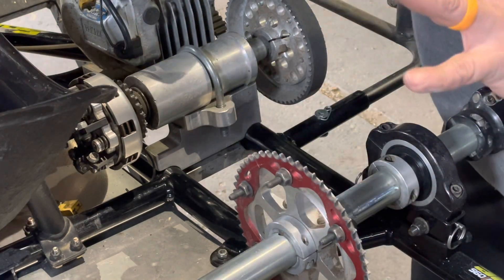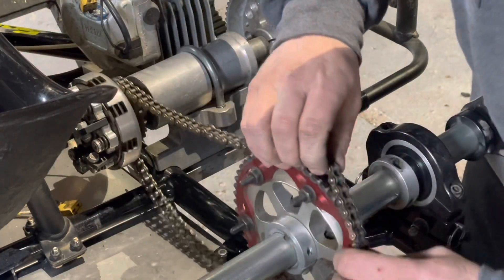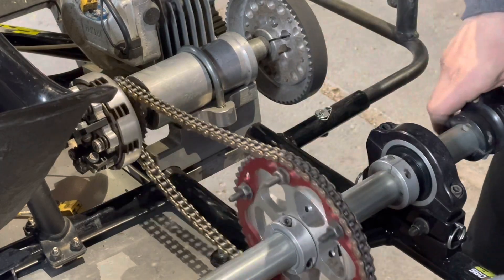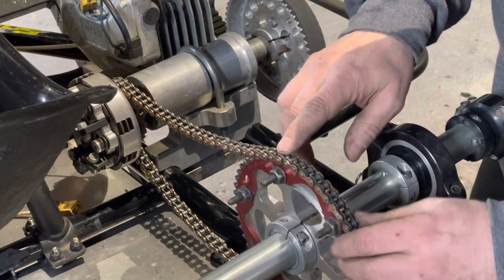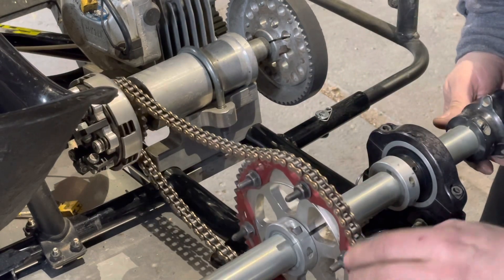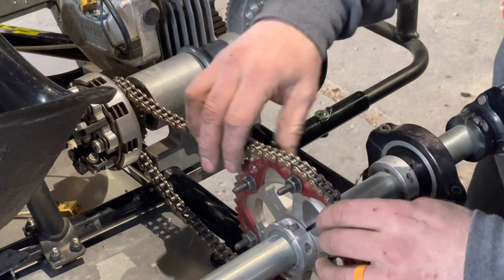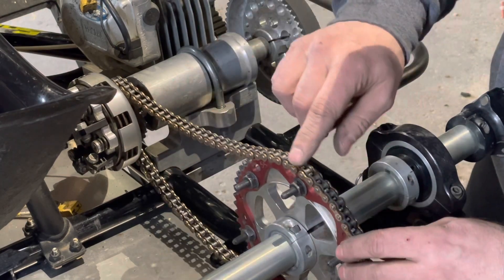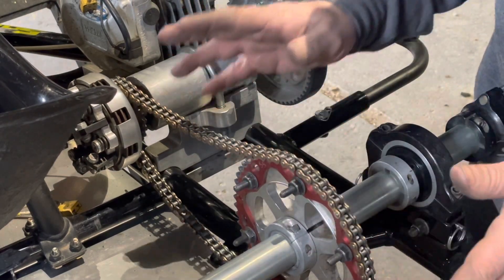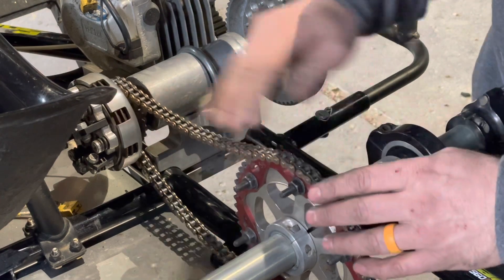Another thing you can do in a quick pinch: you don't have your angle iron, you don't have your laser alignment tool. What you can do is put the chain on. You're going to look for the alignment on the rear gear. As you rotate the chain on the rear gear, it is going to look like it's pushing to one side or the other. In a pinch, you would be able to loosen this hub and move it one way or the other until you see it rotate dead center. You can also get behind it and look down to see it get pretty much close enough. It's not ideal, but in a pinch at the track, look for where the teeth in the chain are running — are they rubbing to one side, rubbing to the other, or running directly in line?